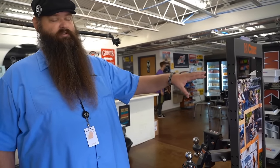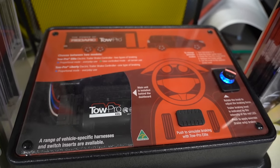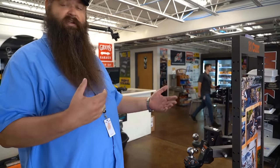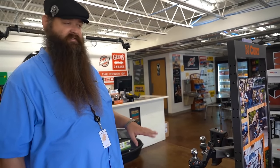You install a brake controller in your truck — if you don't already have one; some trucks do come integrated with them. We have a lot of really good options for brake controllers. Basically, they have an inertial sensor inside, and when you're slowing down it slides a pendulum, so it'll brake the trailer as much as you're braking in your truck — a very even braking experience. We do still carry some older time-delayed designs where when you hit your brake, it amps up the brakes over time. People swear by them — that's what they were using originally before the pendulum design. They work, but they don't work well. They're less expensive, so people grab them. I still say go with a better option because we have some that are inexpensive and do a significantly better job braking.